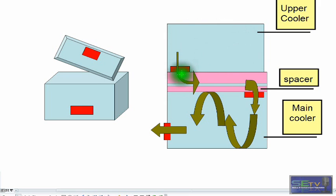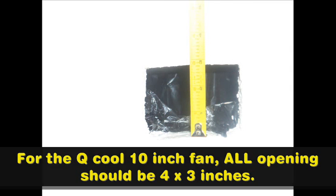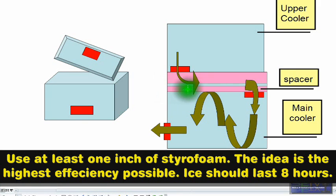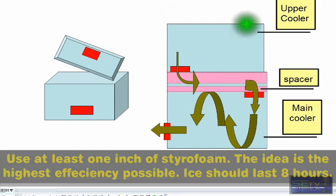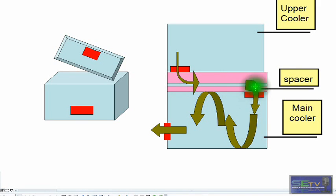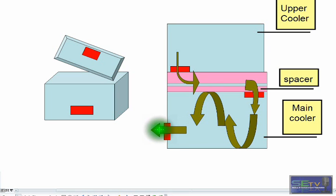Here is the upper cooler with the exhaust hole in it. Here is the spacer with the exhaust hole cut through that, and here is the lower cooler with the exhaust cut through that. This is another spacer to add airspace — dead airspace actually — between this spacer and the exhaust port. You have your fan mounted on the top, blowing down. It goes through this exhaust hole, carries its way all the way across here, which stabilizes the airflow. The airflow then goes down through this port right here and the air circulates around and around through the 15 or so frozen bottles of water until it comes out the side at 40 degrees.